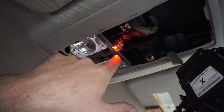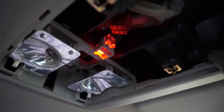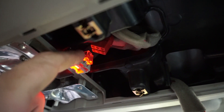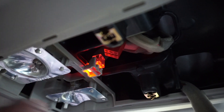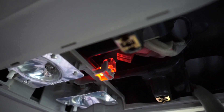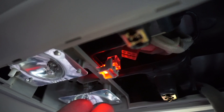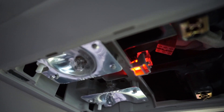Once I pulled it off it was so simple. You can see our new red LED is in place - you can see how it's all fitting up in there nice and neat. One thing I should have covered earlier: your two wires coming up off your LED - make sure to heat shrink those so they don't touch and arc. I forgot to mention that. I put a piece of tape around these, but you can put heat shrink on them. Anyway, that's the finished result - it's in there now. We can button all this stuff back up and give her a look at nighttime to see what she looks like.